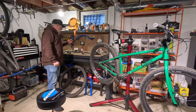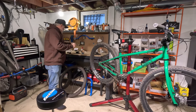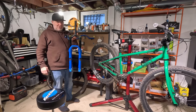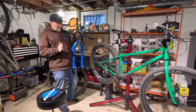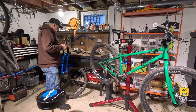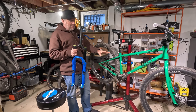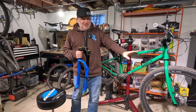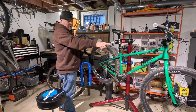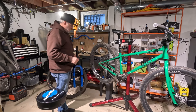I have a 35 millimeter clamp stem and these handlebars because the front end is going to get raised quite a bit when I put this fork on there. This is a 140 millimeter travel 29er fork. So doing this fork plus a mullet setup will definitely slacken things out quite a bit. I'm starting with a 70 degree head angle with the stock fork, so I don't know how slacked out it'll get.